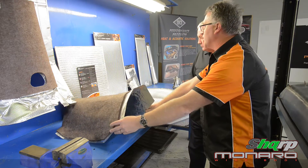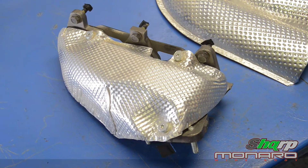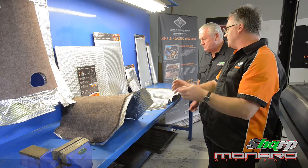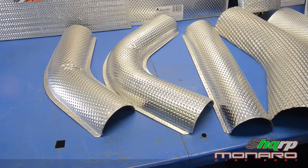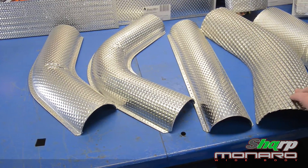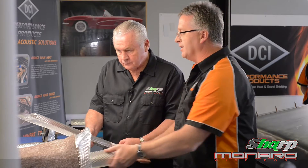From that, we've got a lot of other ranges of products from different applications. For people who aren't quite up to making their own part, we've made preformed products — for a pipe shield, they can clamp it straight on and it's easily done. It comes all packaged ready to go with a couple of clamps. So you can put this over virtually any exhaust pipe, bend it to make it slightly smaller in diameter, and then just clamp it on.